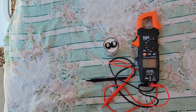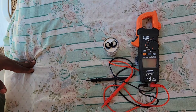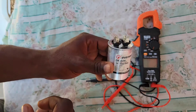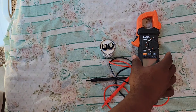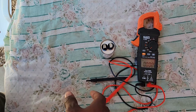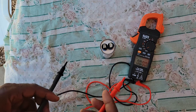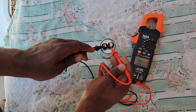After that, you are going to carry out a voltage test. Before you do, check the voltage rating on the capacitor and ensure that your voltmeter is on the correct range. My voltmeter is auto-ranging so I'm good. This is AC voltage.